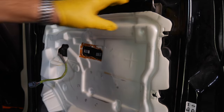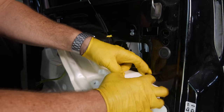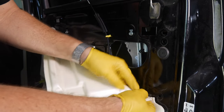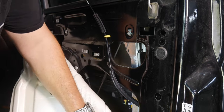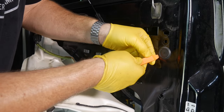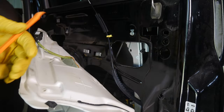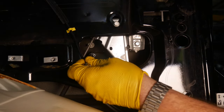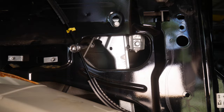Now we've got our door panel off and out of the way. Peel back the vapor barrier — try to keep the butyl intact and just peel it back with the foam so you don't tear it and don't leave any butyl on the door. We don't need to peel the whole thing off, just get access to this area. One area we need is behind this rubber grommet, which is lined up with one of our bolt holes — just pop that out and you'll have a 10 millimeter bolt accessible right through there.